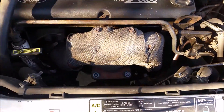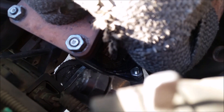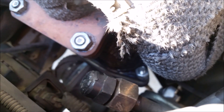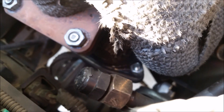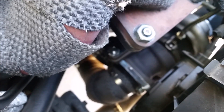Here's the ugly wrapped header. Past that is the adapter plate or adapter piece that hangs off the stock header, and it adapts to a little piece of pretty robust steel that connects to the turbo. The steel adapter piece is wrapped as well. It's pretty small — the inside diameter is pretty small, but it's pretty similar to the diameter of the turbo inlet.